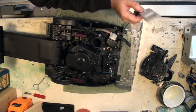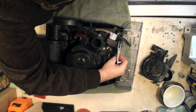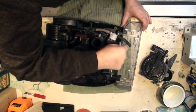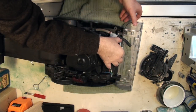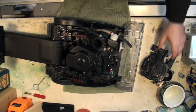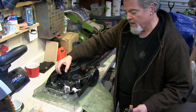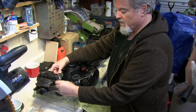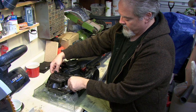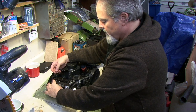Ready to put the brush motor back in. Take your filter, with the hook side toward the front of the machine, drop it into the slot — give it a little squeeze as you drop it in and press it down until you feel it touching the floor. Now set the brush motor in: it has to engage with the brush interlock switch, which prevents the brushes from spinning when the handle's in the upright position. This slot needs to engage with the filter, move the hose out of the way, and the whole thing sits down.